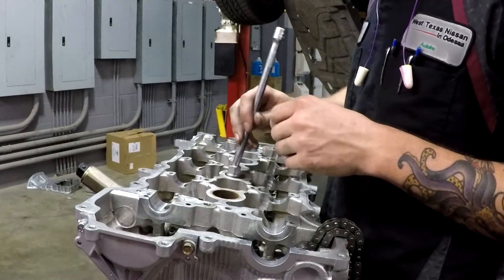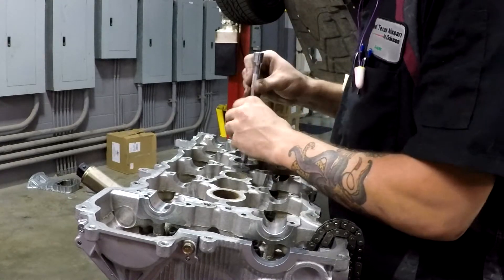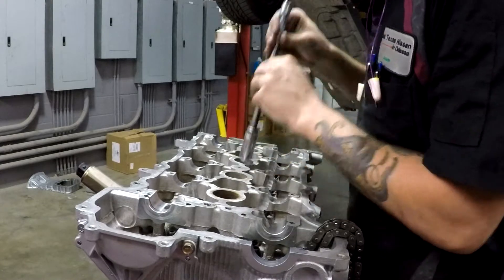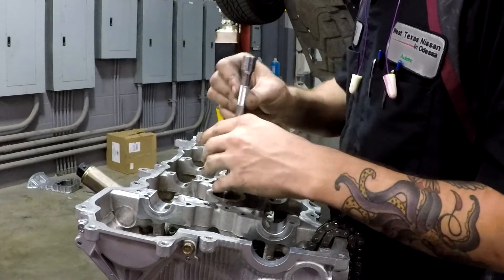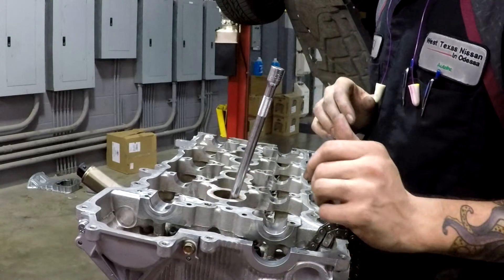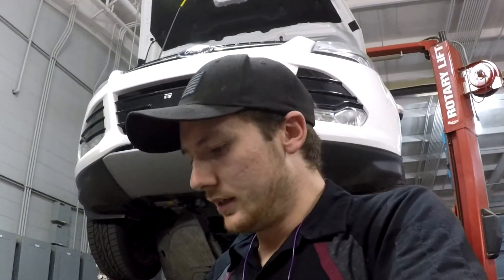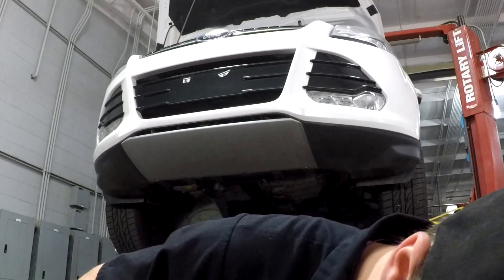I went with NGK heat range 8s — that's the stage-up plug for high boost and an aftermarket turbo, which is what I'm running. I had the 7s for a long time on the stock turbo at high boost and they did well, but this is a much different-looking plug. That's probably going to be it for today — I'm about to pack up and go home. Tomorrow I'll measure for the valves to make sure everything is okay and hopefully the shims don't have to change. Thanks for watching guys — this video was everywhere and I'm sorry, but I look forward to this thing running. The break-in time is gonna suck but I'll see you later.